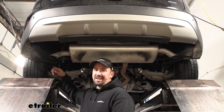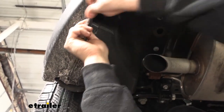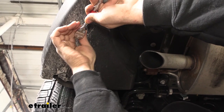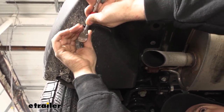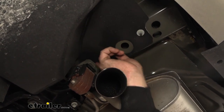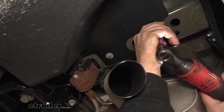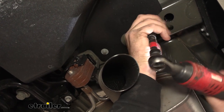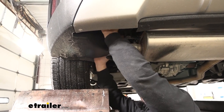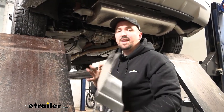To begin our installation, on both sides we have a plastic panel underneath that we need to remove. There are going to be two 5.5 millimeter screws that we need to take out, and we're going to be repeating the same steps on the other side. You're also going to want a nice spot to keep all your hardware organized — it's going to make reinstallation a lot easier. There are also two nuts up here attaching it, and those are going to be a 10 millimeter. With that hardware taken out, this should just pop out. Go ahead and get the other side taken out and set it aside for later reinstallation.